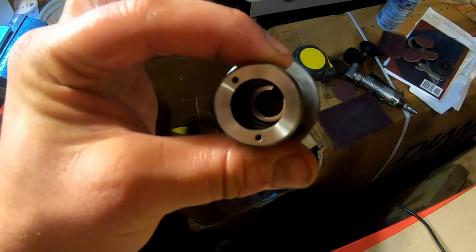Get your feeler gauges, 4 fits, and we'll test to see if it's too much. Oh, 5, that's too much. We'll take that shim out actually. 5 does not fit now. 4 barely fits. That's good. That's a lot better. Now the spacer goes on and your solenoid.